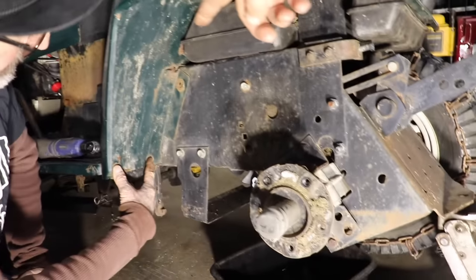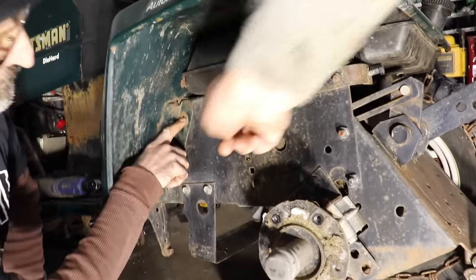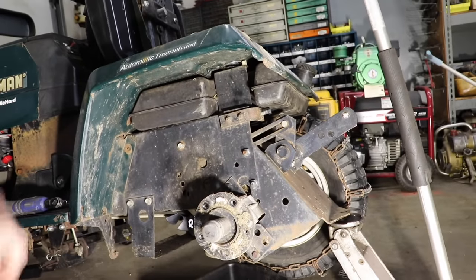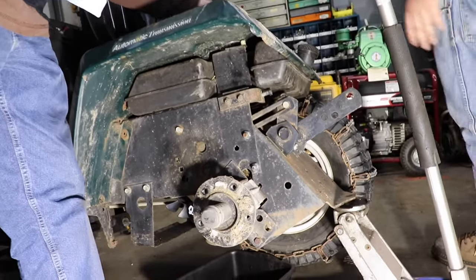And you know what you gotta do to fill it? You gotta pull the fenders, pull the gas tank, and basically you can't actually pull a gas tank on these, you just have to set it off to the side, because there's no shutoff on the bottom. So what does it take to take the fenders off? There's two bolts there on each side, and you got to take your springs off, the two bolts that hold the springs on.